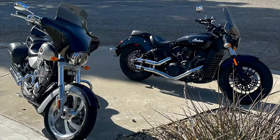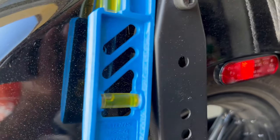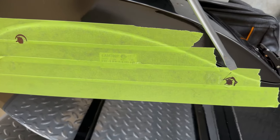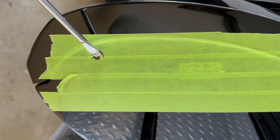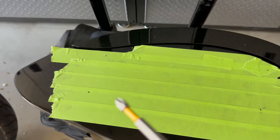Here's a photo of the Black Pearl before I installed the Viking hard saddlebags. The first step is removing the two factory bolts from each side. I mounted the provided brackets and made sure they were level. Next I covered the side of the bag with painter's tape, positioned the bag the way I liked it, and traced the position against the brackets.